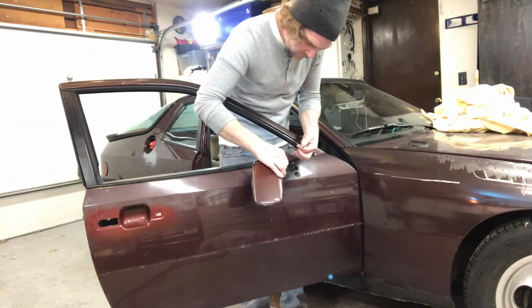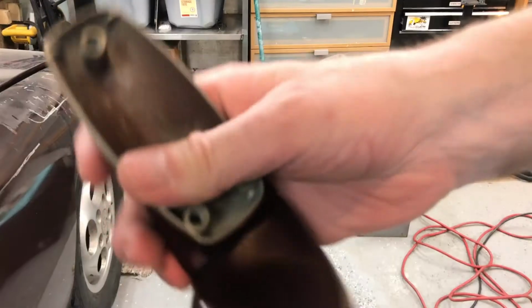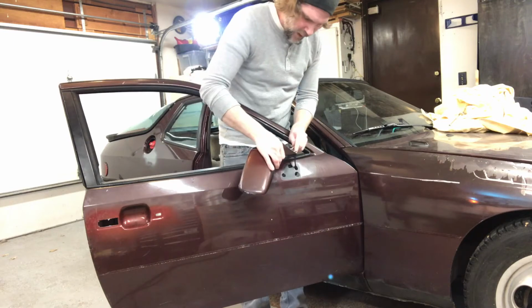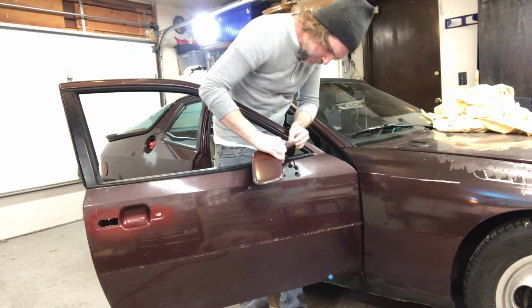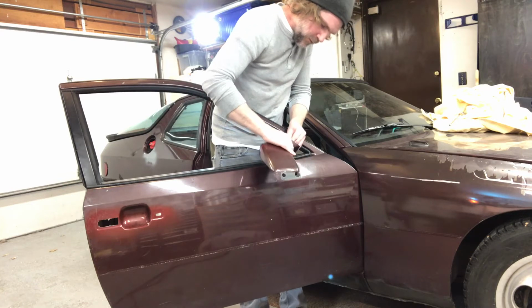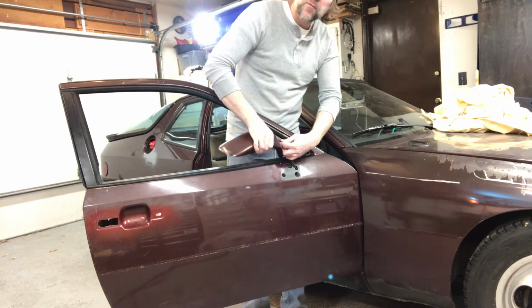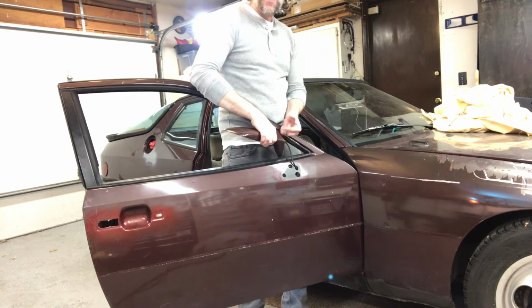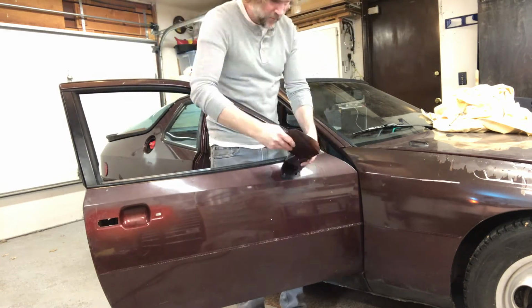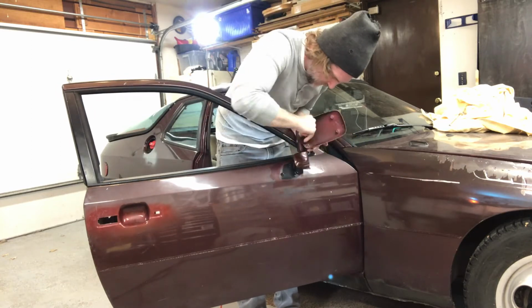So there I'm just pulling the wires through the mirror. It's easier to just start with that part of the mirror. You can see I've got the other part screwed on there right now. I left the one brown pigtail wire down. I got the one single brown one tucked down. And then I fed the wires through the mirror and pulled that short brown wire back up once I got the whole width of the wires through the mirror.